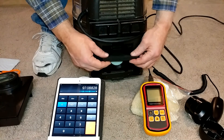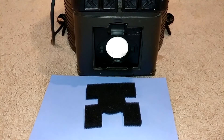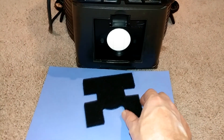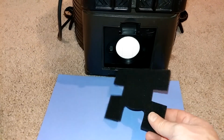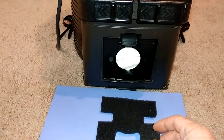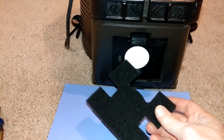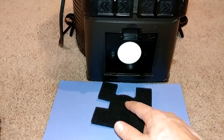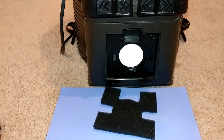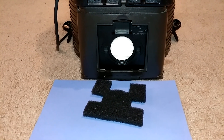So, better particle filtration and better airflow without the foam filter; worse particle filtration and worse CFM with the foam filter on. My recommendation is frankly to remove it — but that's up to you. As a final comment: I was able to figure out how to get it out without tearing it. This little post-HEPA filter really just seems to be foam — nothing special at all. It lowers airflow and increases particle count. Those are two giant thumbs down. So I'm going to leave that little post-foam filter out, but the choice is yours.